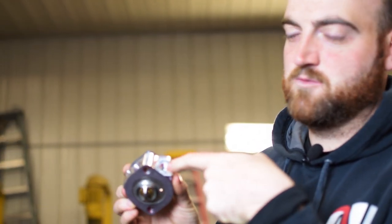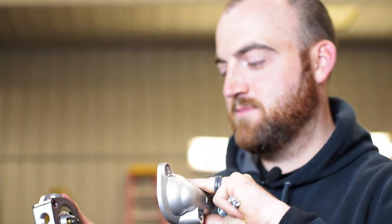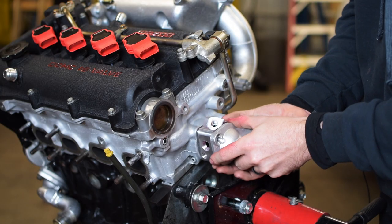It prevents tons of leaks. We're also going to want the Kia water neck — that's going to be the whole sandwich assembly. This is what you use as your heater core port, so that's going to face towards the exhaust side of the block. There's also a spare port, which we're going to use for a water temp sensor — this is where the ECU water temp sensor goes. The piece ends up tagging on together and you'll have a nice rear assembly.